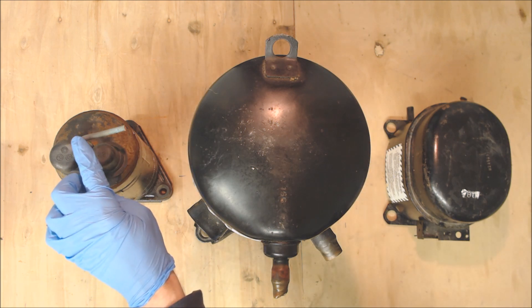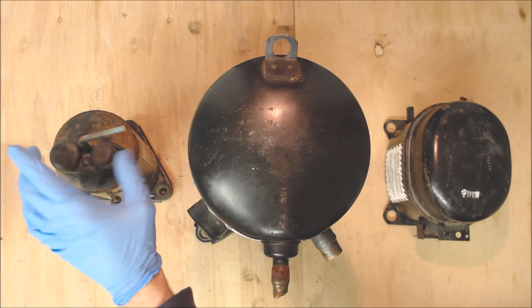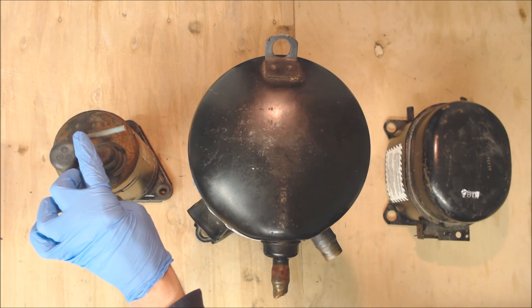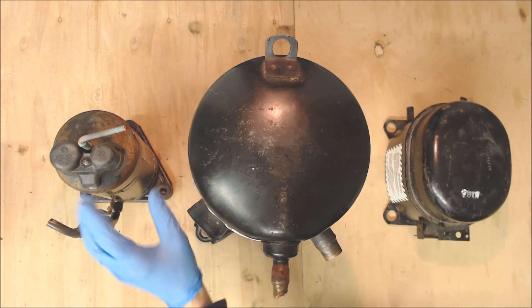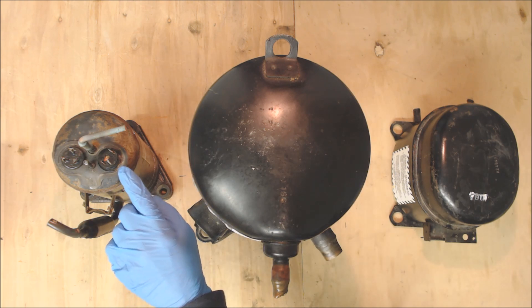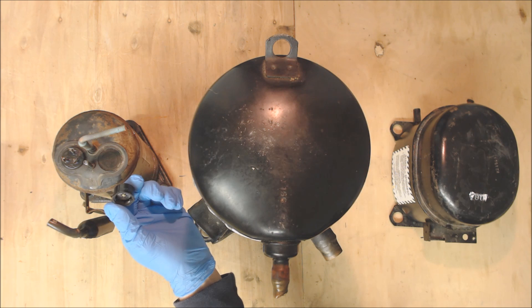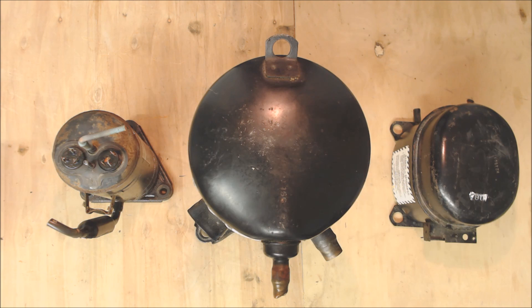So this one right here is a rotary. You see that you're looking at it from the top down and you see that it's round. The discharge tube is on the top — that's how you can tell it's a rotary compressor as well. It has an accumulator on the side, and it also has the electrical compartment on the top. You may or may not find the compressor protector, which is basically just a thermal overload, and if it gets hot it's going to open the electrical circuit and not allow power to the electrical windings.